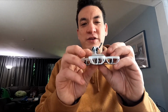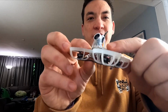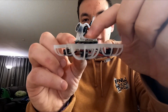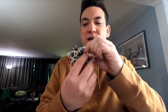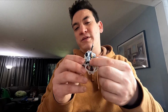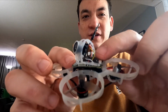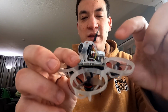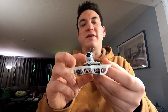It's kind of got a new cam holder, and one thing to watch out for, I'm not sure if they're going to fix this or not because I don't have the production version, but my cam holder kind of squished the update, the little update plug, and I was able to bend it back enough that I could get the plug in there to do an update, but just watch out for that. The way it pushed pressure right on top of that kind of long tiny little plug there, it squished it down and broke it, probably in a crash at some point, but yeah,